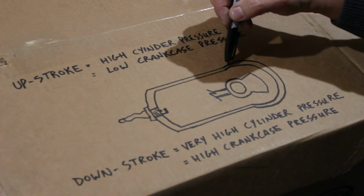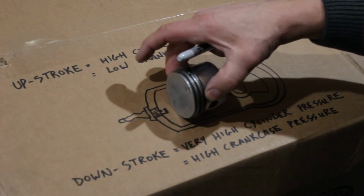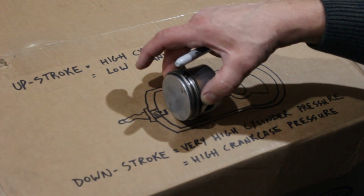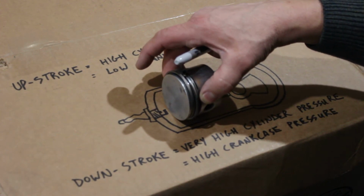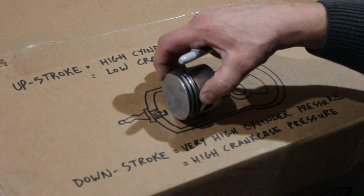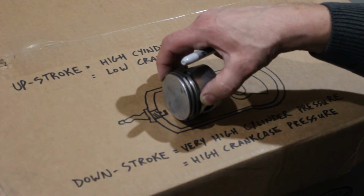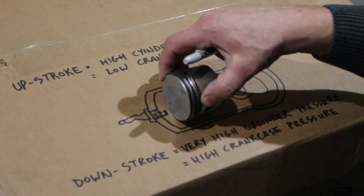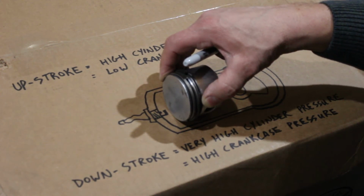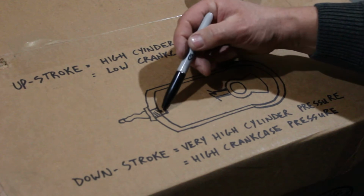This is the crankcase down here. This is your cylinder, and here's your combustion chamber. So when the piston comes up in the cylinder, it basically comes to about there, and you have a little bit of a hemispherical shape. That's where the term Hemi comes from, by the way. Hemi is short for hemisphere, and Dodge did a brilliant thing back in the 60s by actually patenting. They took out a patent on the term Hemi, and then they claimed that there's all kinds of engines that have hemispherical combustion chambers, but Dodge, Chrysler are the only ones allowed to use the word Hemi because they patented the term. So brilliant piece of maneuvering there. You can see the bottom of the spark plug electrodes right here.